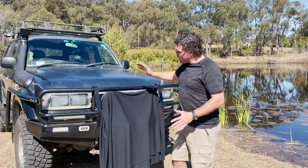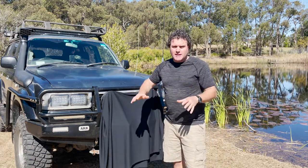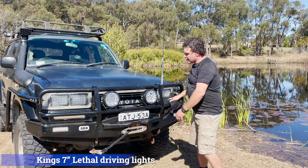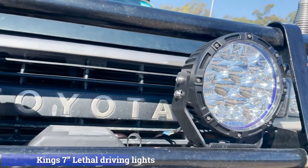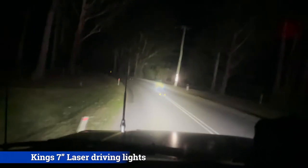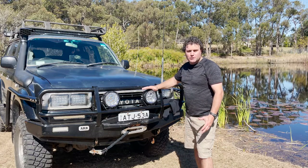I've got the lights mounted on my car - out of the Kings Laser, the Kings Lethal, and my eBay ones from my previous video - and I know you're all waiting for the big reveal. Three, two, one - I decided to go with the Kings Lethal 7 inch driving lights. The reason I chose this: although I like the color temperature a little warmer on my eyes, with the lasers I just couldn't get over the two dinner-plate-sized spots right out in front of you. For a dead straight flat road they would be an amazing light - they produced the distance they claim and they're a phenomenal light.